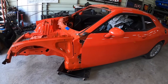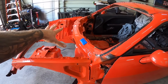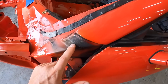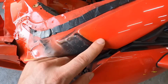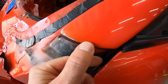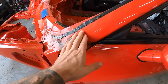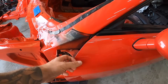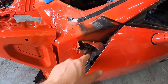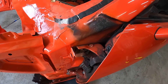The goal for this video is to tackle a few small areas. Once we clean up the major areas, we're starting to notice some of the smaller areas we need to tend to. Right here at the bottom of the A-pillar, it's got a little bit of char — the very bottom is a lighter orange. So we're going to sand this and clean it up. To do that, we're going to pop the door off so we can get in here and get the hinges cleaned up.